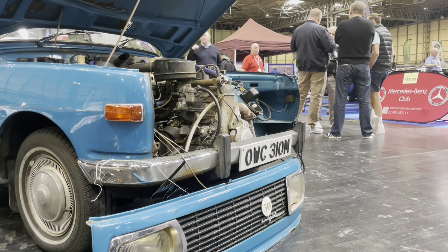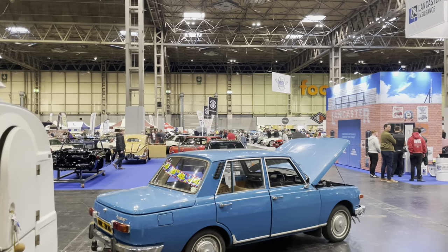I did manage to drive the blue Wartburg back. At the show I got a plastic pulley off Simon Clamp when picking up the orange Wartburg on Saturday night and fitted it at the show. The other problem I think may have been causing pulley issues is that the dynamo was on a bit of a wonk - a Morris Minor dynamo had been fitted. I put a direct replacement on, but because the mount points are very slightly out, the pulley was too far back on the spline, so instead of a straight belt you've got it running on a wonk. With the dynamo readjusted at the show we got it back together and drove home.